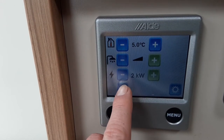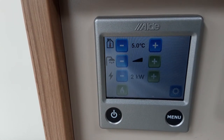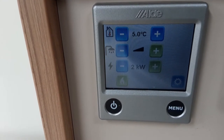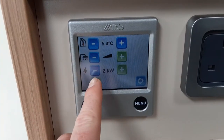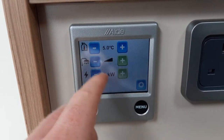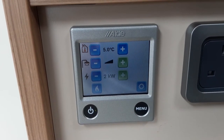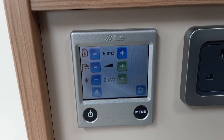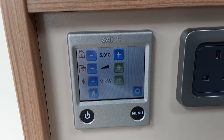If you want to run the heating and hot water on gas, simply hit the gas button here and it will self-ignite the gas system as long as the gas is turned on. If it doesn't ignite first time, make sure the gas bottle is turned on, then come over to the hob and get the gas through to the hob, as that is the last point on the gas system. There are also options for setting the timer for the heating and hot water via reading the manual, as going through it in the video would take several hours to explain.